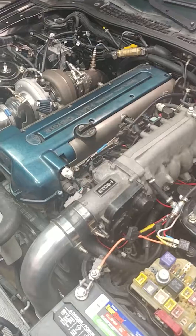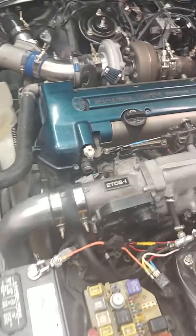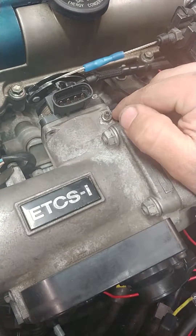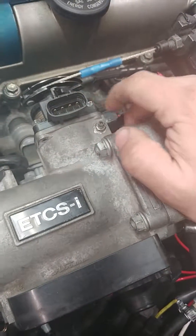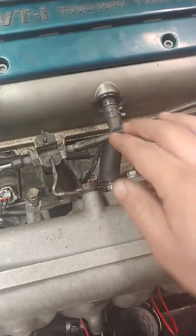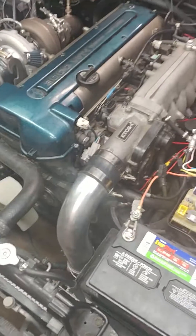When you get all that done, you're ready to start the car. You should have fully foot-activated throttle. Your check engine light is going to be on. You might have to adjust your idle — mine was at 1600 to 1700 RPM. Loosen this nut and turn this to adjust your idle. You may also have to adjust these two nuts over here to give you more slack if needed.